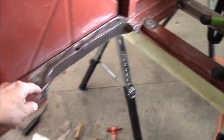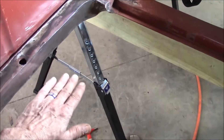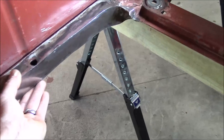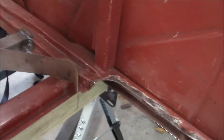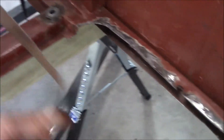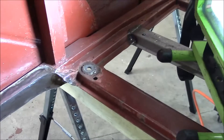Way back when, I had to cut out this area of the subframe because I Z'd my frame, and the Z in the frame comes up here. So basically it looked like that - I had to cut out a section. What I did is I took some metal and formed it around there and filled that area in so it's like a box. I just took a strip of metal, bent it over a little pipe on each end to the right length, stuck it in there, fit it, and welded it. Sanded it down, ground it down, and that's that.